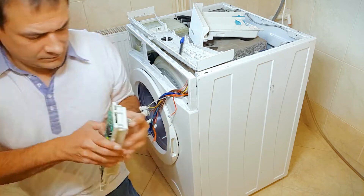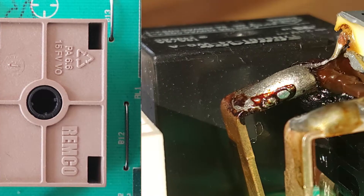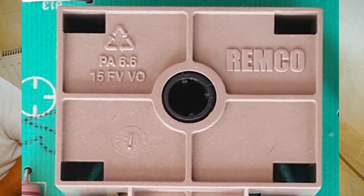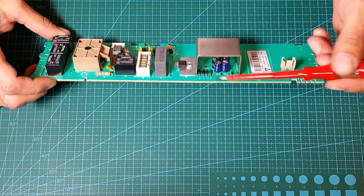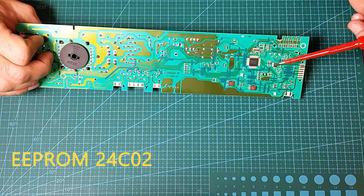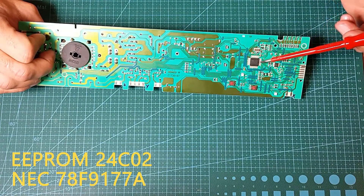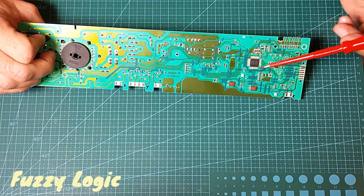Take the PCB out. From the first glance I can tell there is a burnt, melted switch. The manufacturer of this PCB is Remco. I checked the machine's power consumption and found it consumes 10 amperes. All the other elements seem to be well preserved. Here we have AC-DC converting elements, four AC relays, some transistors, EEPROM 24C02, and a microcontroller — a NEC 78F9177A, which is an 8-bit microcontroller. Enough for some fuzzy logic.